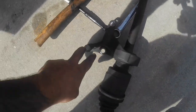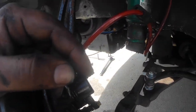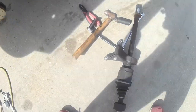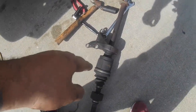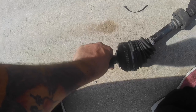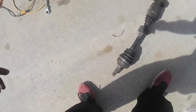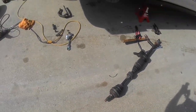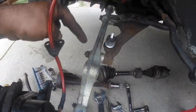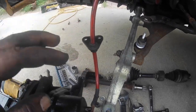To get this off you just have to remove these three 14mm bolts — I dropped the fork already. I never have good luck separating these two, so I'm just going to take a big hammer and bang this axle to get it to separate. There's a half-inch slit somewhere on this boot — that's why I'm changing it out.